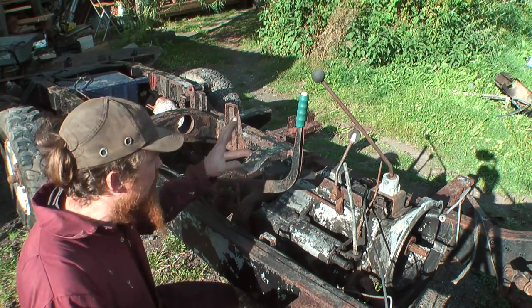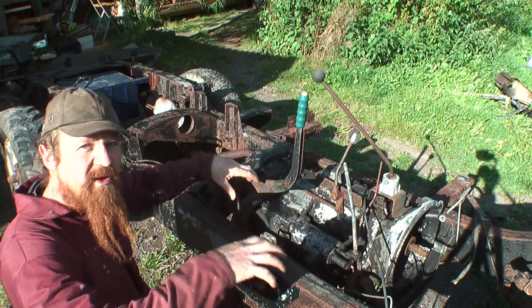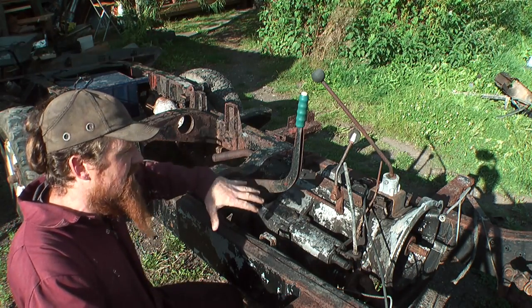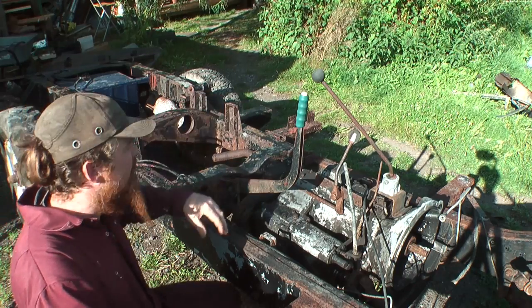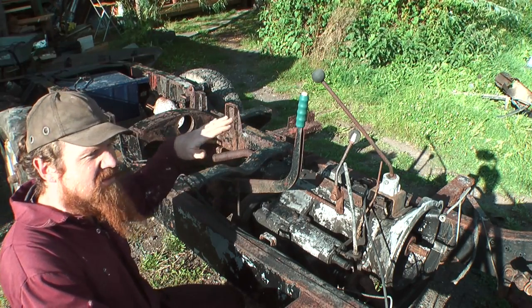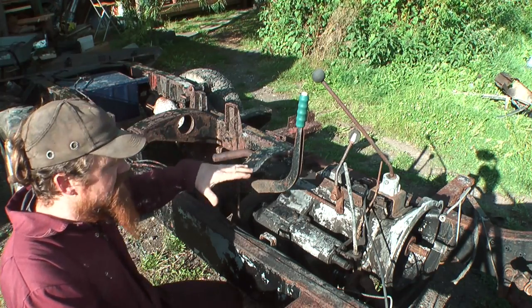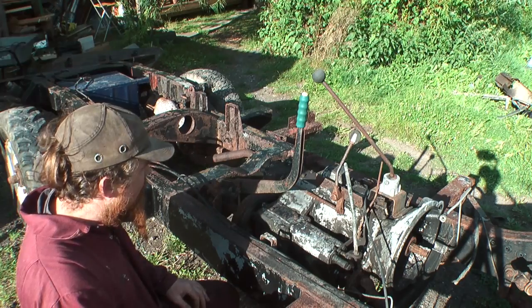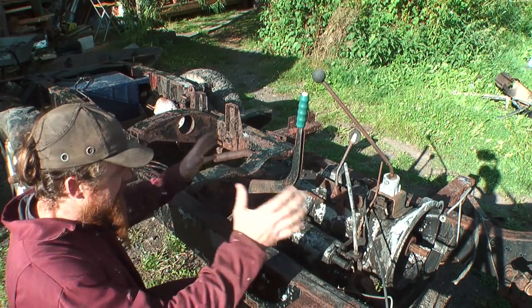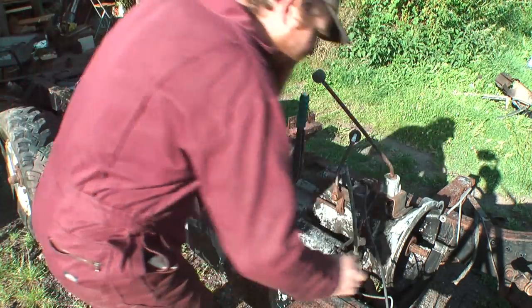So what that'll do is, low range would be unaffected, but the high range, the normal gearbox gears, will be a bit higher. And I think fourth will now be roundabout where fourth overdrive would be. So it's just four gears, but they're all higher. So yeah, that's a whole unit, which is over there somewhere. That's ready to go in here.